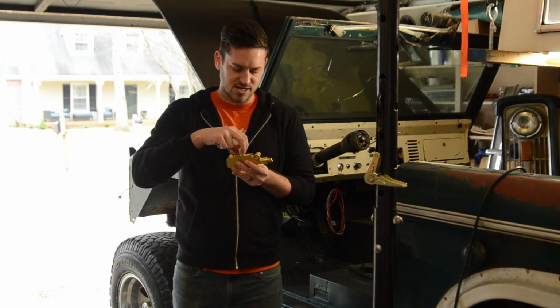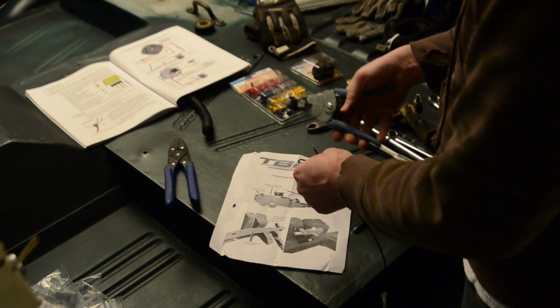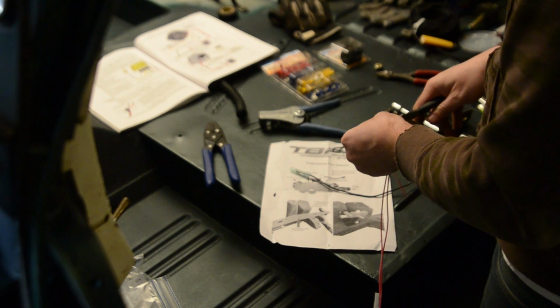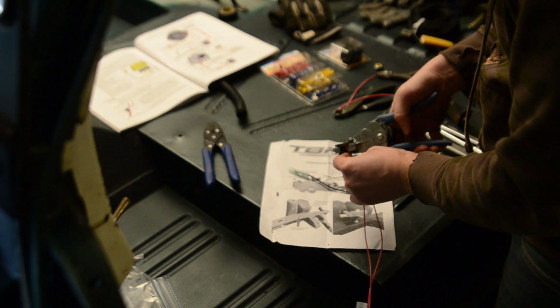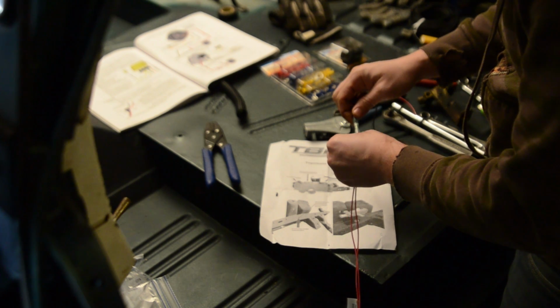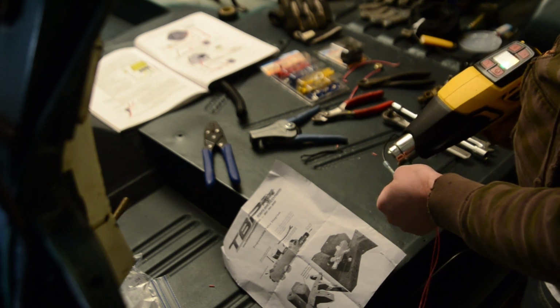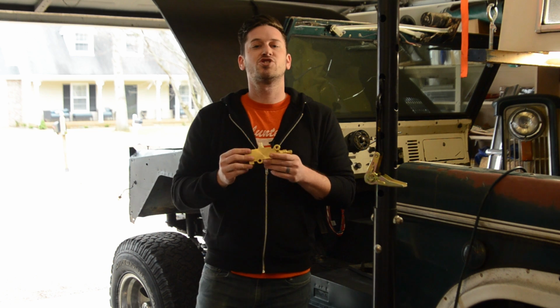So very efficient. The final step is cutting your new brake warning wire and installing it into a butt connector to install it into your harness. My harness came with 2 wires for the brake warning switch, and per Tom's Bronco instructions, you put both wires into the connector together to make the connection. So that's it, a little disc proportioning valve tech for your day.